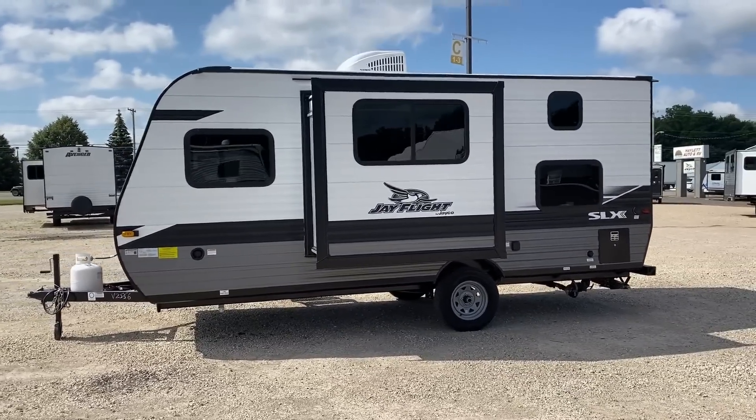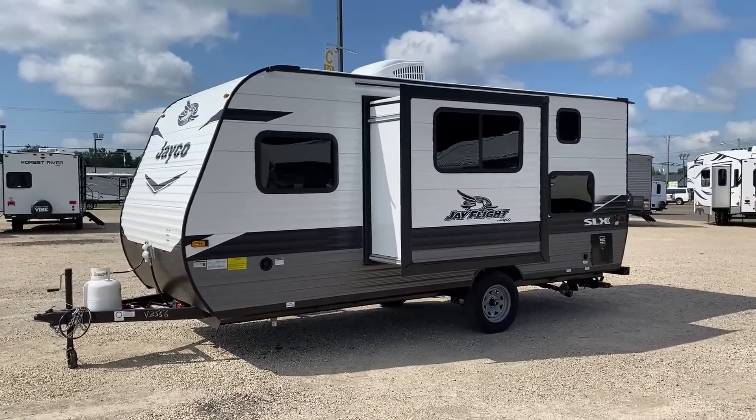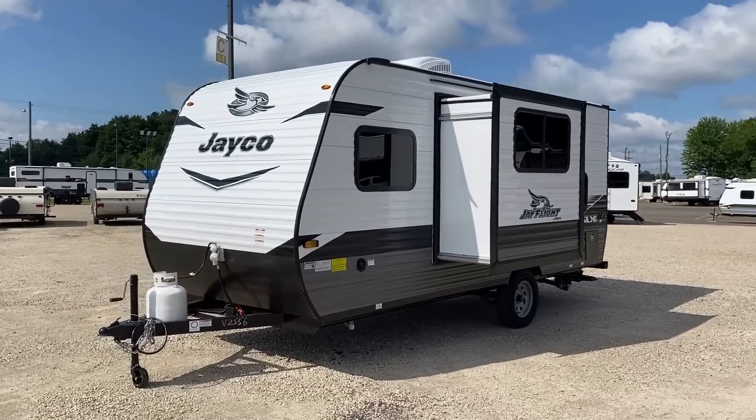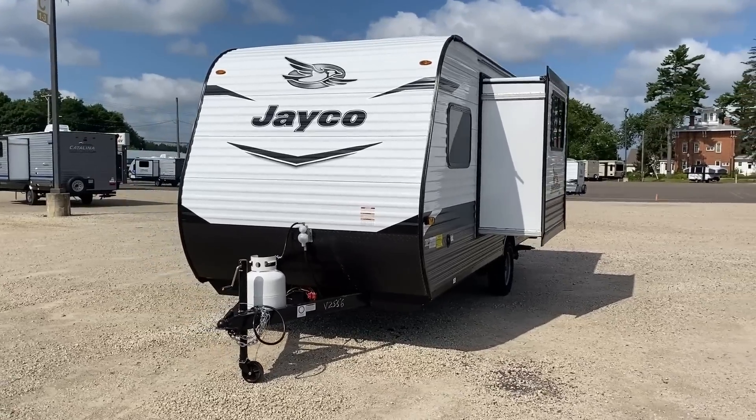There's a classic callback to that Jayco blue in the decals, and on that JFlight branding it has that same deep, rich blue outline. The water heater is gas and electric, auto-ignition, and fast recharge — you can run gas and electric simultaneously and get just shy of 18 gallons of hot water per hour. The only window on this that does not open for airflow is just that upper bunk window, which I'd love to have open for air, but considering that's normal in this class it's not really a knock — just a preference item.